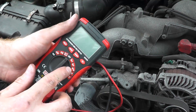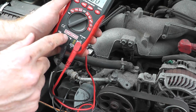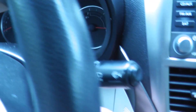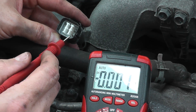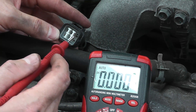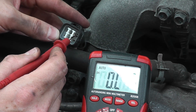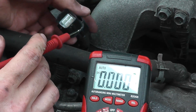If you've never used one of these, it's very simple. We want the VDC volts setting. You have two leads: the black lead is your ground — put it to any good metal point on the vehicle. With the red lead, touch the prongs. There are four prongs on this harness connector. You want to see at least 10 volts, ideally 12 volts. Touching the top right-hand prong, we have 12.4 volts — that verifies power is getting to this harness connector. The wiring is good.